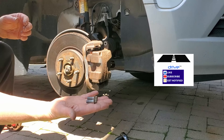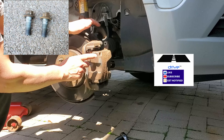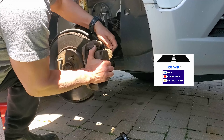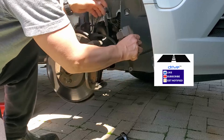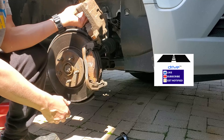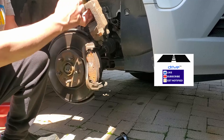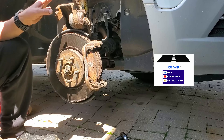I've removed the two bolts. They're not very big but they do a very important job. The next thing is to wiggle out the caliper in order to gain access to the two worn pads — just move and wiggle it out. When you remove it you can see that it's attached to the hydraulic line. Do not let it hang because you'll ruin the hydraulic line — it might crack or bulge and your brakes won't work. A lot of people zip tie them to the strut.